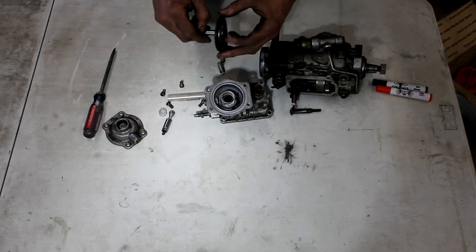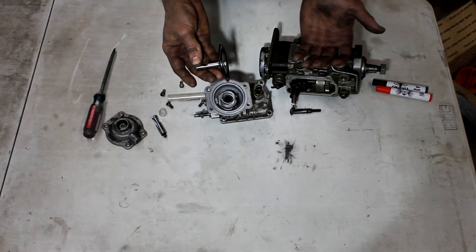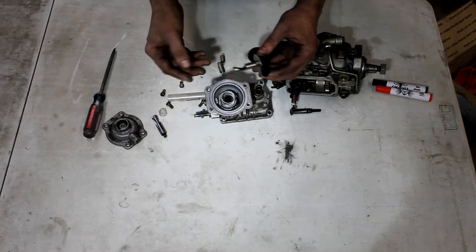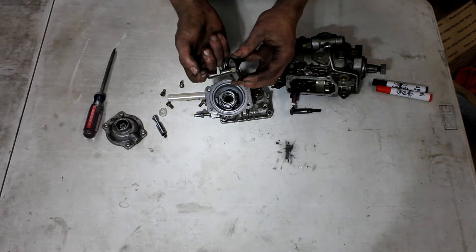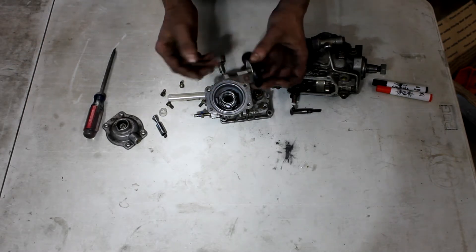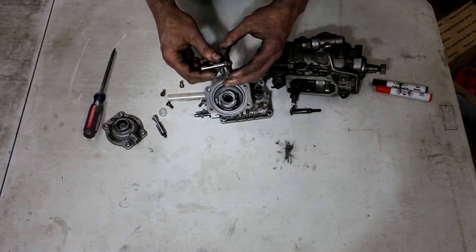I've never personally ground one, but it's pretty cheap to just get a fuel pin. Hungry Diesel, M&H, and Denny T still all make parts. This is a stage two. If you drive the truck on the street and want to tune it, especially with a low stock converter or manual, go with a stage one - a pin with a convex profile instead of this concave profile. It will be much easier to tune. For competition use, we always recommend stage twos or the concave profile.